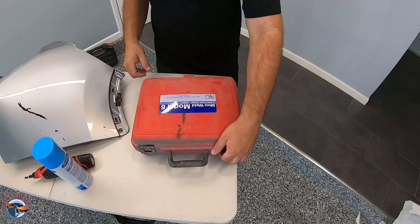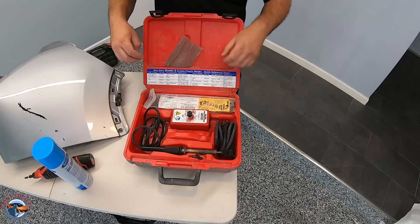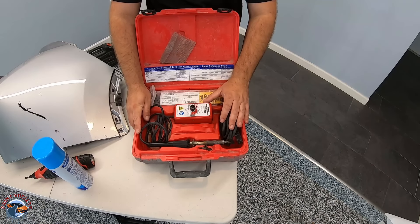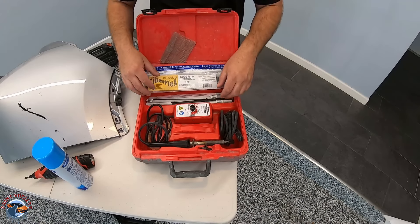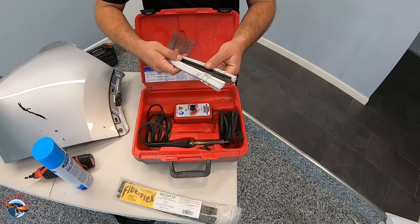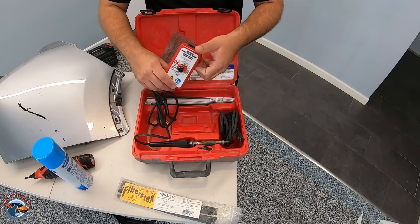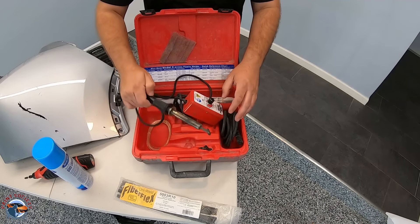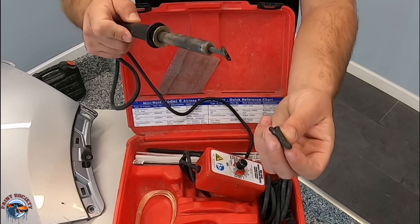And lastly we have our welder. If we take a look at our welder, we have everything that we need in order to make this job happen. This is a very basic plastic welder — I'll put the link in the description — and it utilizes heat at different temperatures in order to melt the specific type of plastic back into your bumper. The kit comes with fiber flex rods, which we'll be using today, as well as a whole bunch of different types of plastic rods. The module can be set at different temperatures, and you have two welding tips: a flat iron type and one that accepts the rod going through it.